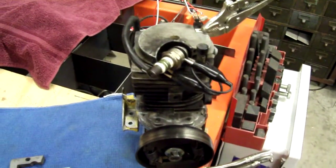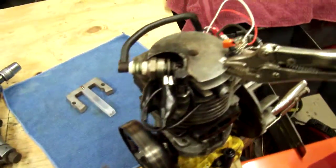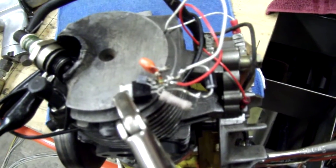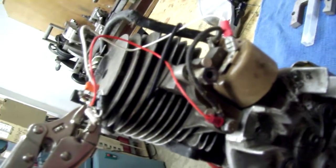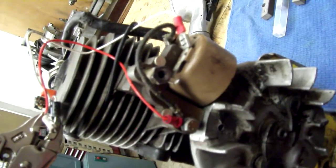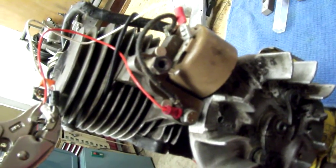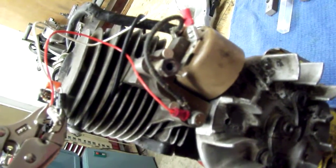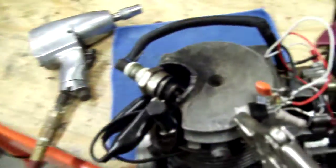Here's a little circuit you might be interested in. I built this circuit to excite the primary of the coil on any engine. The coil is hooked into the little circuit, so the circuit excites the primary. When the flywheel comes around, the magnet inducts into the coil, and then the secondary produces high voltage which sparks the spark plug.